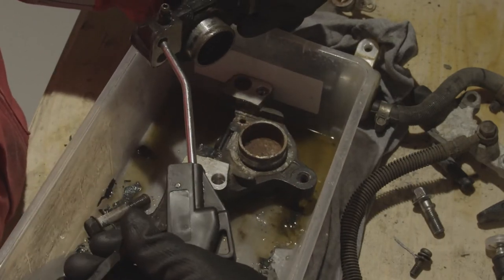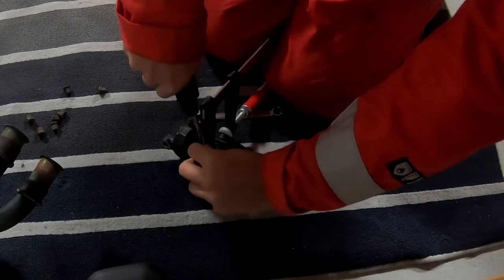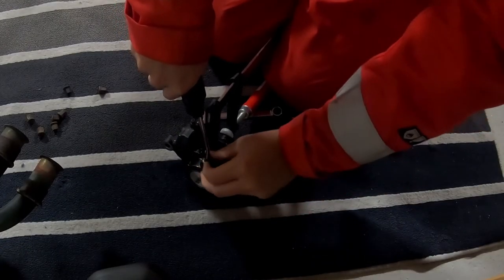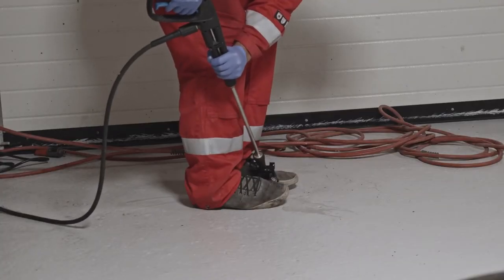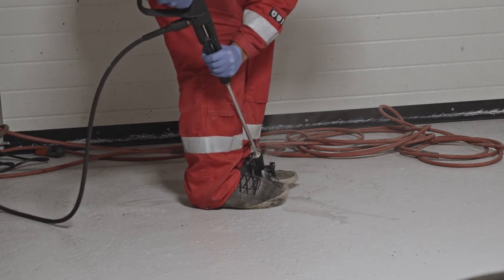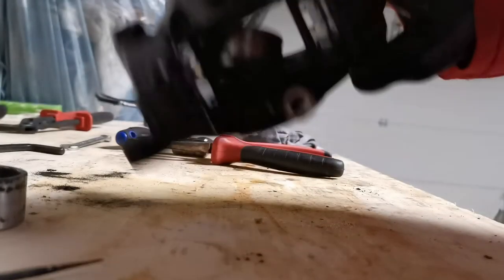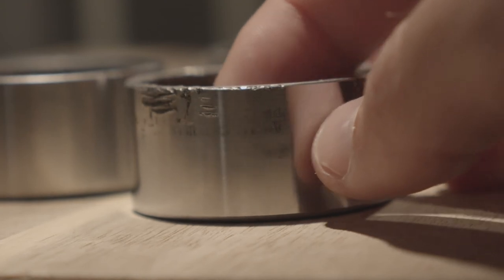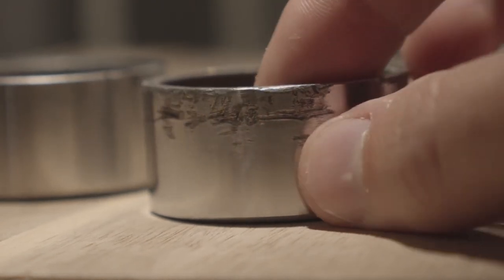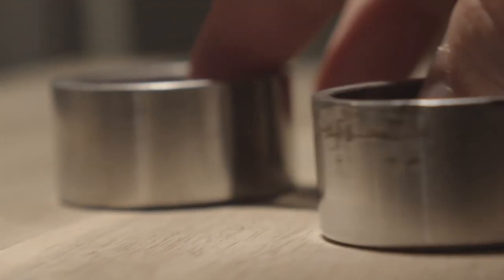Make sure to wear gloves for this - as you can see I was not prepared for this the first time. I had two pistons that would not budge with air at all, and the way I dealt with it - which I have not seen anyone else suggest online - is to use my pressure washer. That worked great, and when this thing finally came out I was so happy because I didn't know what to do or what to try next. So finally it was all disassembled and ready for cleaning. After getting these piston rings cleaned I could see that the previous guy who had these out did not follow the internet's advice about not using tools to damage them, because these were pretty badly damaged - and this was definitely not my doing.